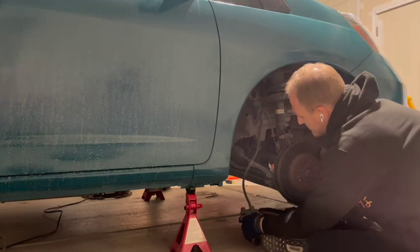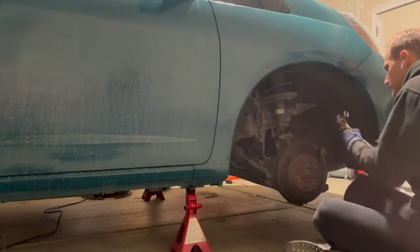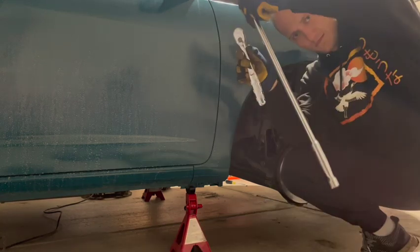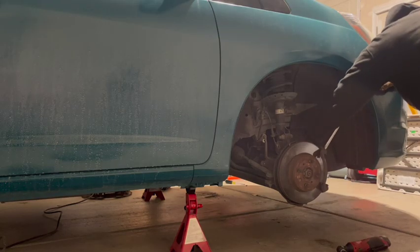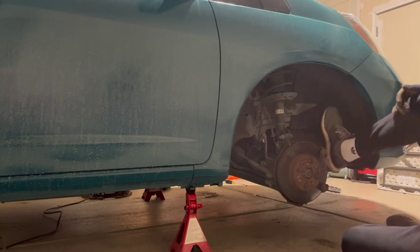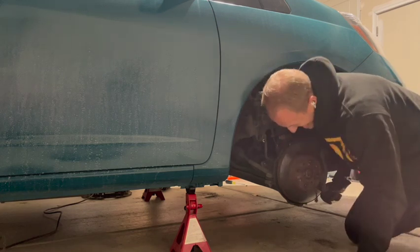It barely doesn't reach the ground, so I rested it on the control arm. If you're having a hard time getting a bolt off, try a longer handle. If you're having a hard time getting the bolt off again, try an even longer handle. It should work great. Sometimes it's a little bit tricky to find a convenient place for it. Suspension parts are torqued really high, so be prepared to fight them to come off. Just make sure that you're pulling or pushing the right direction, or else you might get the bolt off in an entirely unexpected way.